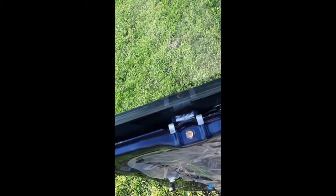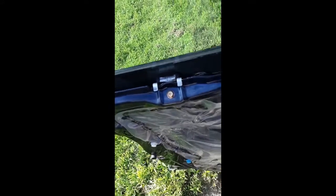And the way you get the door card into this car is you sort of snug it at an angle under the mirror, and you slide it along this rail, and then you pop it down to the point where the window, there's like a fuzz on the window that interfaces with the glass. It fits correctly here. You just sort of wiggle it around and it'll fit in eventually. And you kind of put it in at a slight angle. Once it feels like it's hanging correctly, you should just be able to push the door card into the door.